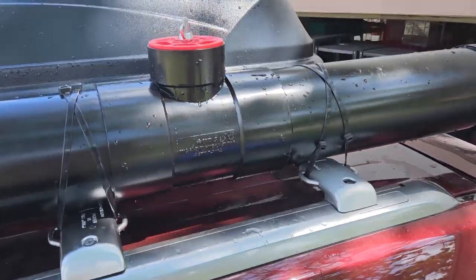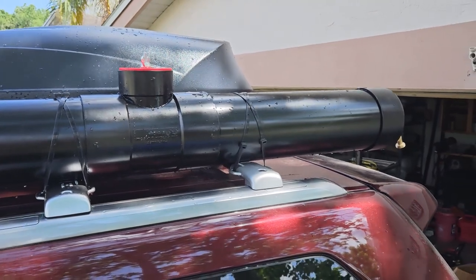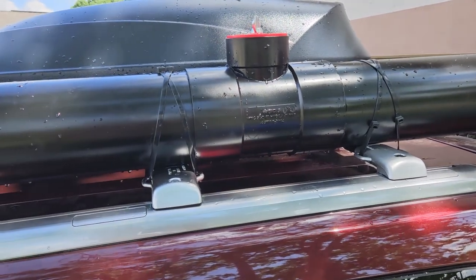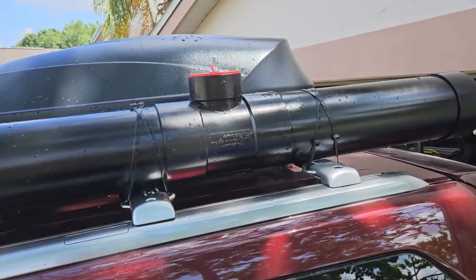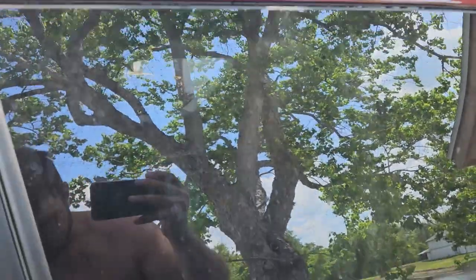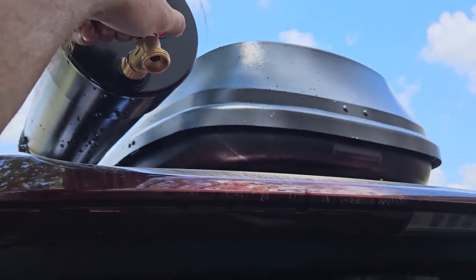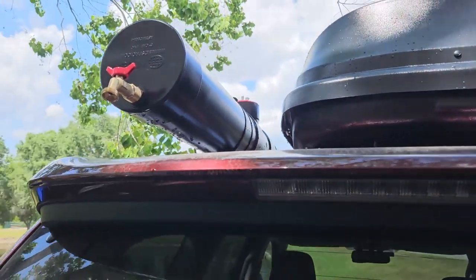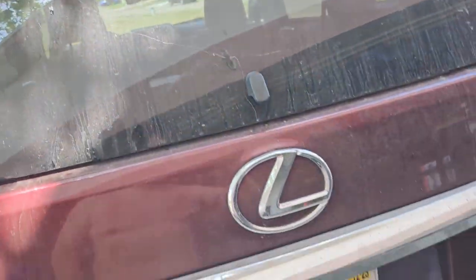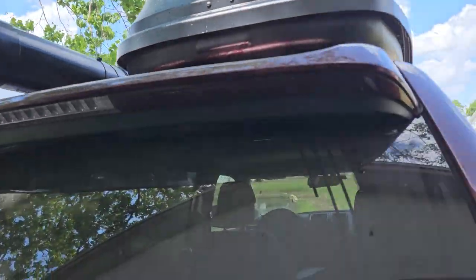So it's full of water - that's why everything's wet. Got my test cap in there, feels pretty good. One thing that's interesting to see is if I have this thing totally empty, so it's full of cold air and that air expands, will it pop my test cap out? So I need to put a tether on that, and also so I don't lose it. This is far enough back where you can conveniently come over here and hit this knob, get a little bit of water to fill a cup, wash your hands. And I'm going to have an adapter that screws on here to a shower head so I can comfortably stand behind the truck or off to the side and take a shower - that water should get nice and warm after a while.